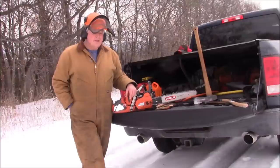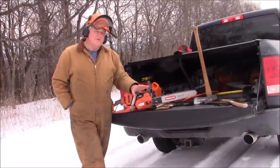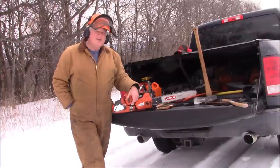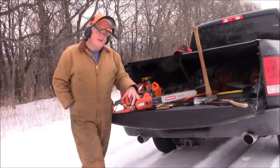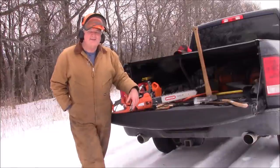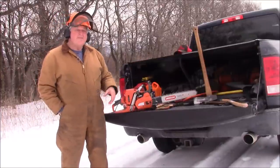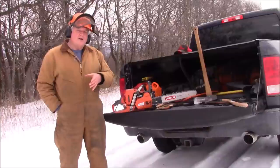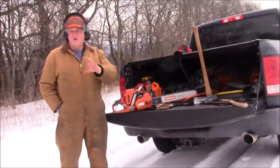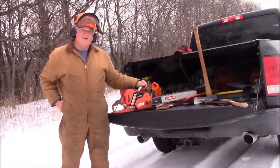It's a reliable system. The saws that they wrapped that system around, on the other hand, had to be evolved. And that's not because of Autotune, it was because of the cylinder design and basically their desire to try to trap heat. I went into that in one of my other videos, where the basic mechanical design of the saw created heat issues that showed up in things like boiling gas in a carburetor, vapor locking. It had nothing to do with Autotune. For that matter, Autotune allowed it to work around some of those problems. So those two concepts, the mechanical design of the saw plus Autotune as a system, you've got to separate them in order to really get a true picture of what's happened with today's saws.